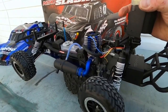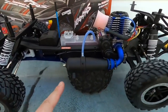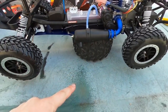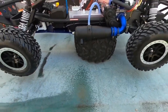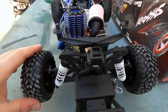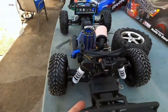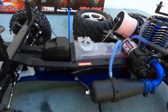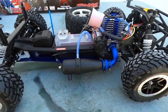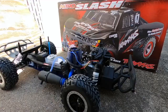First start. I'm going to monitor the tune. I see a whole bunch of oil coming out — it's running super rich already. Traxxas seems to have a fairly good first tune on it. The tune was actually probably a little bit too low, so it's so rich it tends to shut off sometimes. If you're asking what do you do now — you fire it up again and adjust the tune slightly. Maybe we need a little higher idle speed. Trial and error — let's fire it up again.